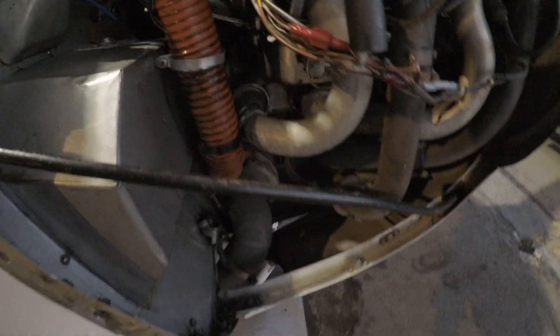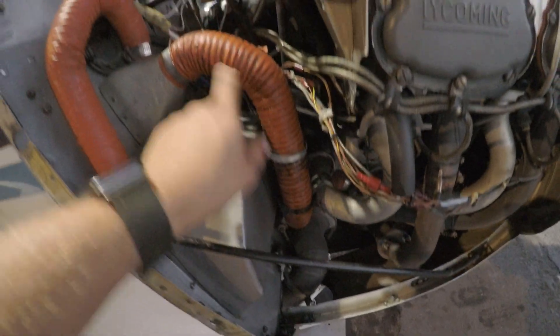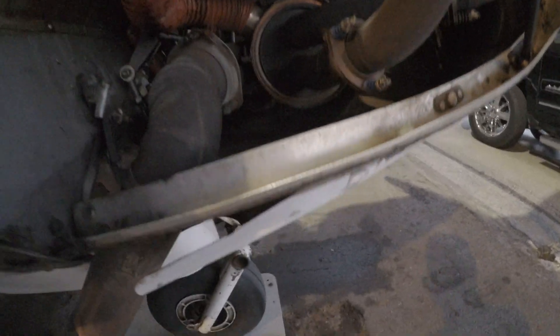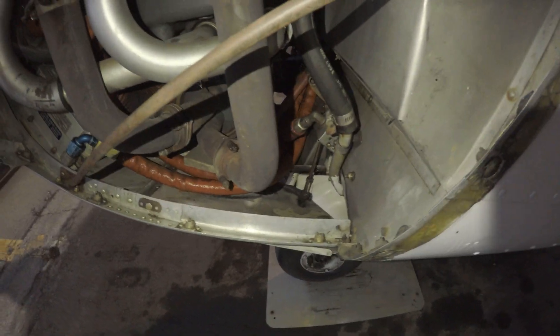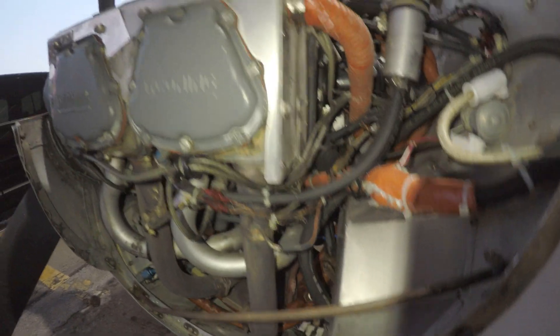Now's a good time to just look around and look for oil leaks. The only spot where I see oil collecting is right here, which makes sense because we fill it up here and it's pretty easy to spill. But other than that, on the bottom of the cowling it actually looks remarkably clean in there — it's kind of hard to see without a light. All the rest of these look good; I don't see any signs of oil on the bottom there, on our cowl flaps. Everything else up here looks pretty dry, so I think we're in good shape.